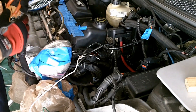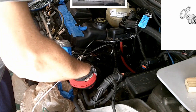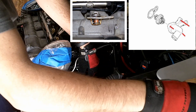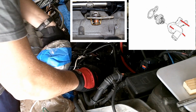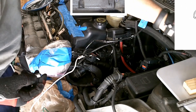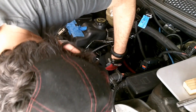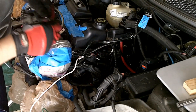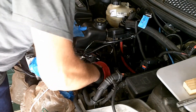We are going to remove the thermostat here on the engine. The thermostat assembly has three of its six bolts that are very hard to access, because on top of the thermostat housing there is one bracket where all the connectors go — oxygen sensor, temperature sensor — they are all tied together there, and some other cables pass through, making it very difficult to access the bolts. The position of the bolts is like a triangle: two on top and one on the bottom.